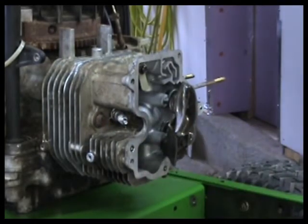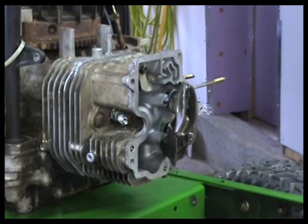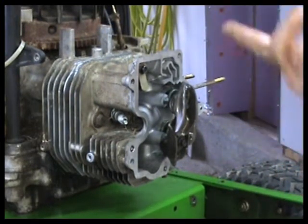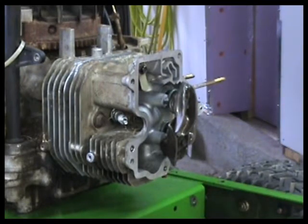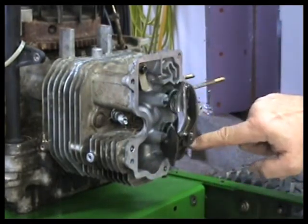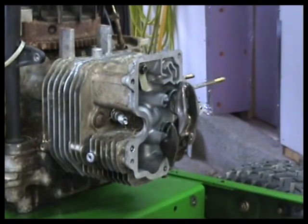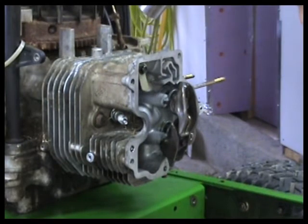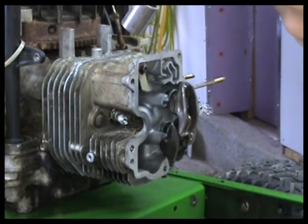Okay. Now, seeing that the manual doesn't show me a specific torque pattern with five, I'm just going to use a star pattern here, just like you would putting lug nuts on. I don't know how critical it is on these, but that's just my habit to do it this way. I always do it the same when given a choice. So we're gonna go first up here,